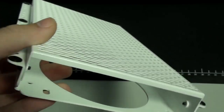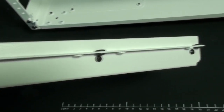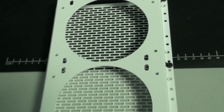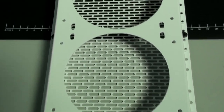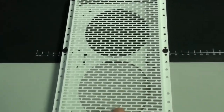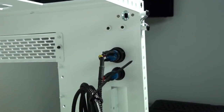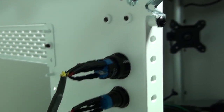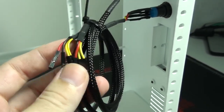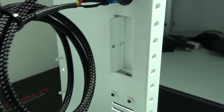The screws actually screw in from the front side, so the cover panel needs to be removed to access the mounting screws for everything that goes into the 5.25-inch bay. Even the ventilated 5.25-inch bay cover panel has this same design. You can also see there are anti-vibration grommets on all of the holes that fit onto the rods. Looking from the other side of the case, next to the 5.25-inch bays you can see the power and reset buttons. The cables for these are sleeved, but there is still a lot of wire exposed - it's a reasonable sleeving job, but personally I always redo CaseLabs sleeving.